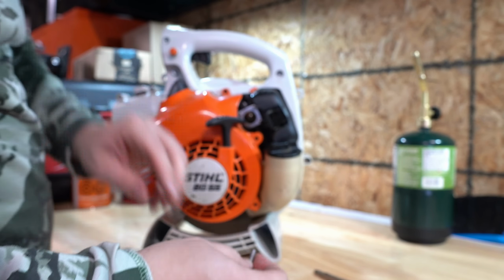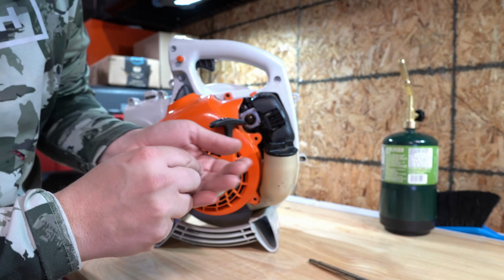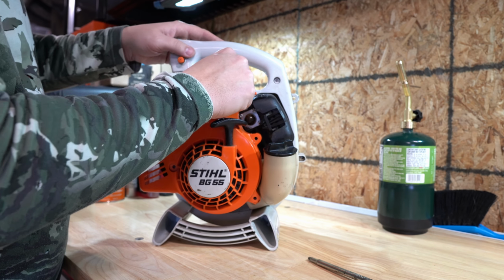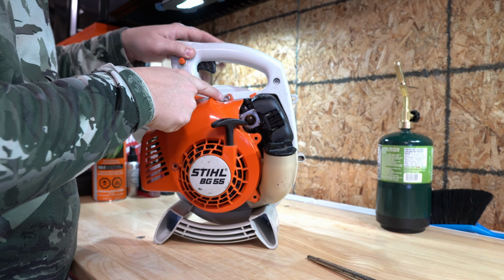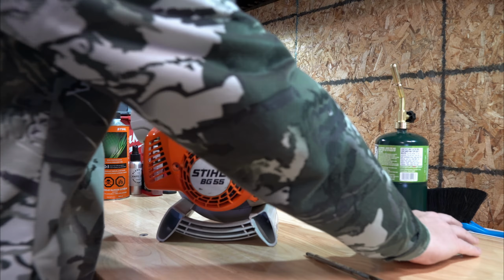Of note, when you pull this cover off, there is one bolt out of the 4. I don't know if you can see them. Right there. That's more coarse than the rest. The coarse bolt actually comes out of the top of the casing here, in that spot. Just keep that in mind when you go put it back together. Take off our cover. Put it to the side.